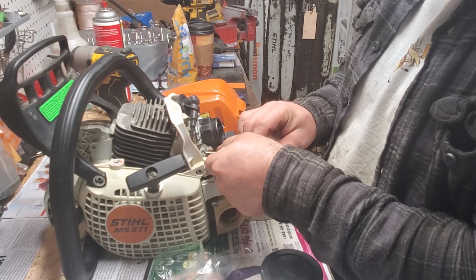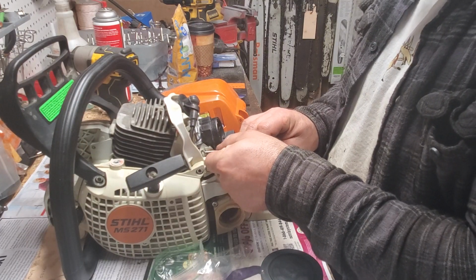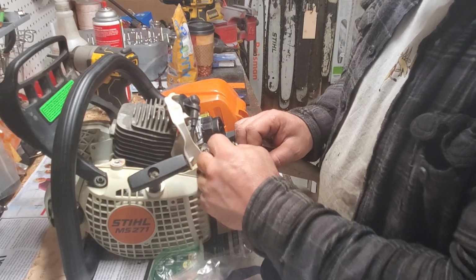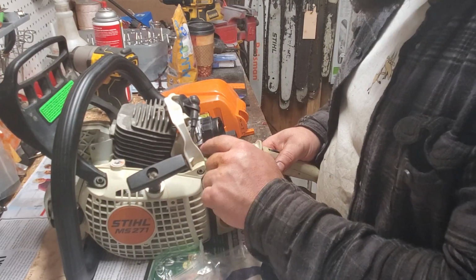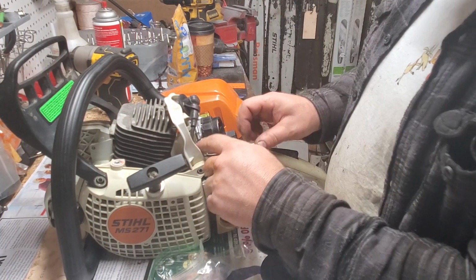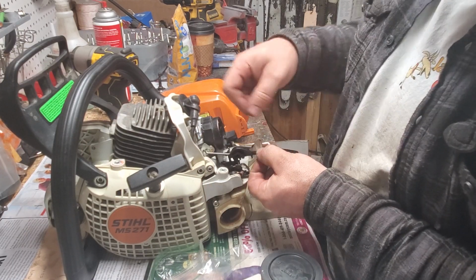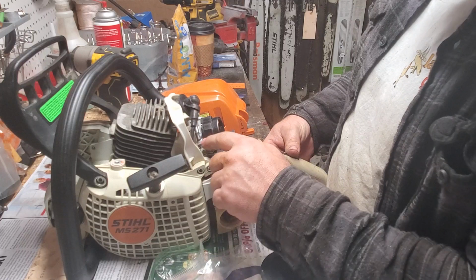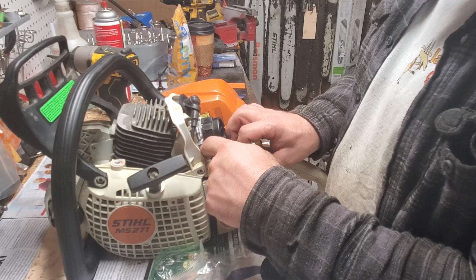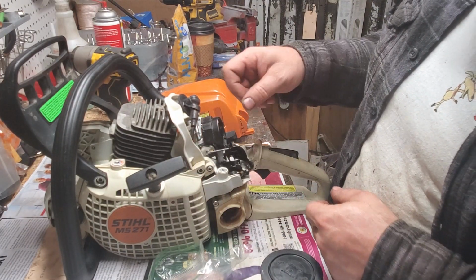And so what happens is when this is on the saw, and you end up moving this lever, if I can show you guys, it will end up on this one. It's got a push. Your throttle will end up being out of the way. It'll just push your choke lever like that. So you'll do that, pull your trigger, and it'll hold your trigger or your throttle about 3/4 open. When it's engaged, your throttle can't come back. And then when you flip this up one, you'll be at 75% throttle and about 50% choke.